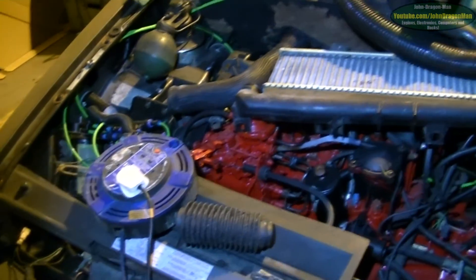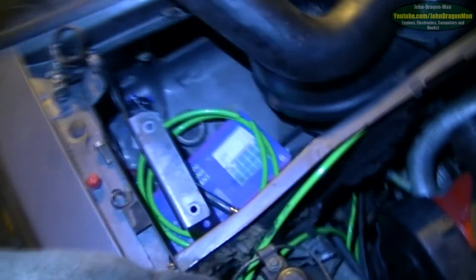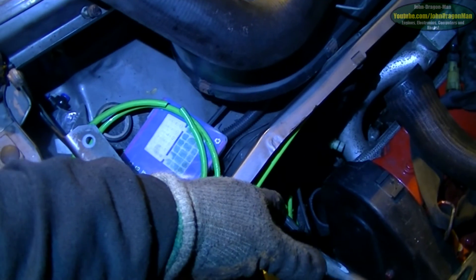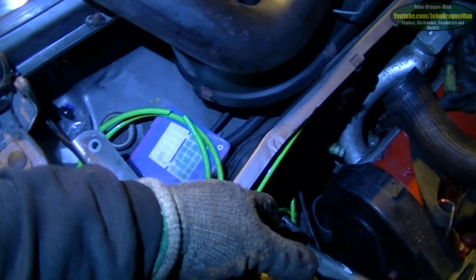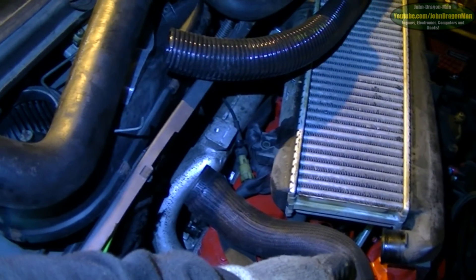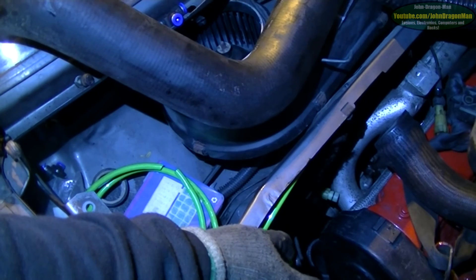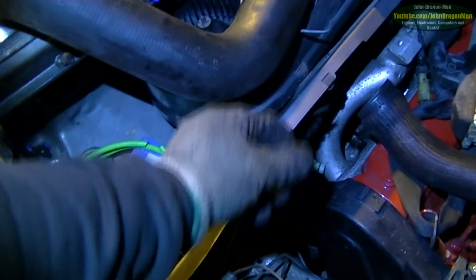It's closing up time at the yard, all the shutters are going down and lorries are parking in the yard. I've ordered a few parts for this as well. The boost piping is giving me some issues — it's a 50/51mm turbo outlet going into a 45mm, so I'm going to get a 51 to 45mm reducer elbow and have a 45mm pipe coming up, then another elbow coming along and into the intercooler. That's what this pipe used to be for on the original turbo.